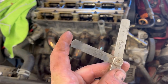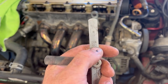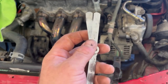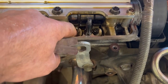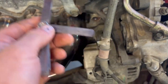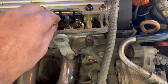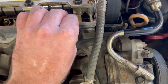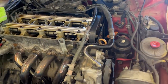These are the feeler gauges we're going to use — .008 on the exhaust side, .006 on the intake side. These ones are easy to find since I use them a lot; I've even got them a little bent. What you're going to do is loosen these 10-mils right here, then since this is the exhaust we're going to do .008 — slide the feeler gauge in between the cam lobe and the rocker. You want slight drag, which feels almost perfect right there. We'll put it to spec anyway and show you guys how to do this.